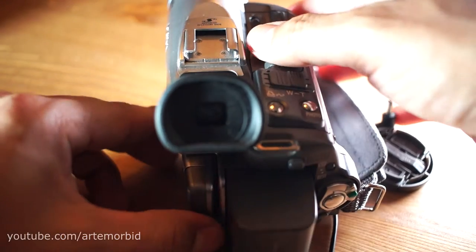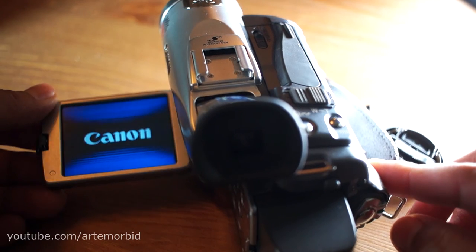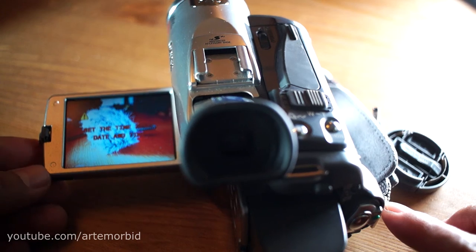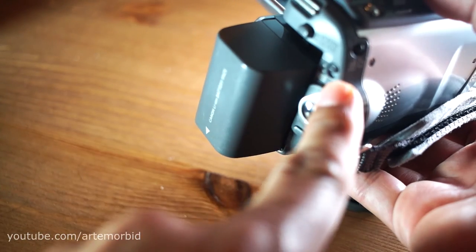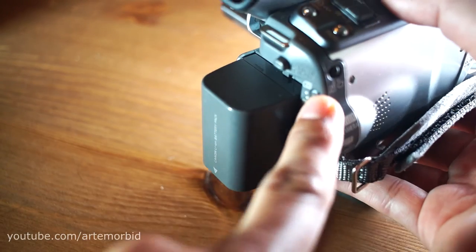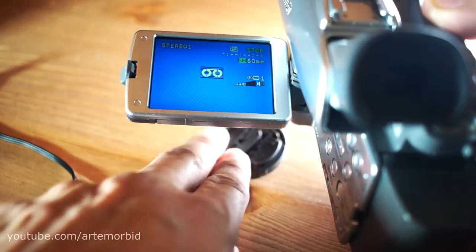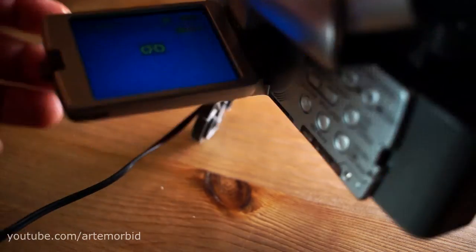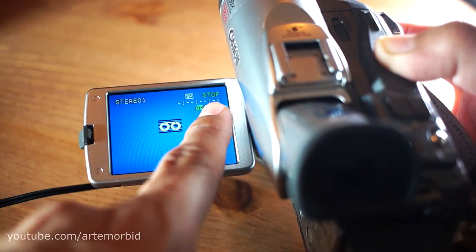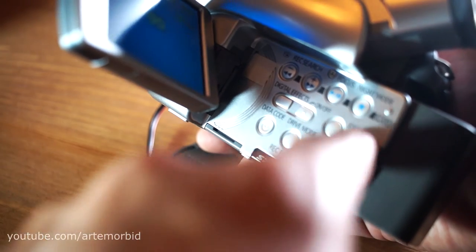Open the camera screen and turn it on. In playback mode with the tape in, it's showing card playback because you need to turn that small knob from card to tape. Turn it to tape and now it's asking me to charge the battery pack — the battery is running low, so I'll plug it in. Now it shows 60 minutes — this tape is blank — and here are the controls: play, reverse, forward, stop. You've got all those available for tape playback.